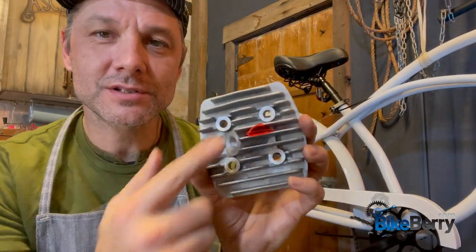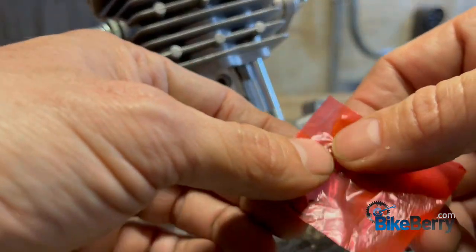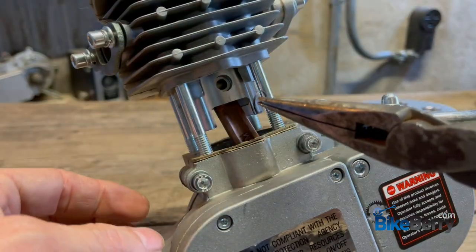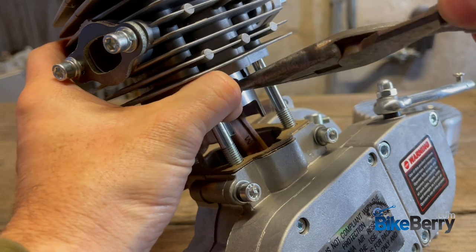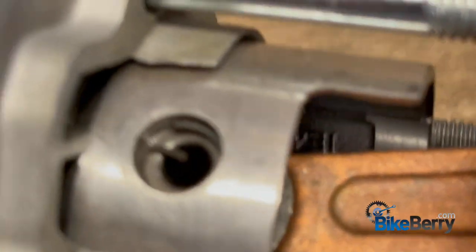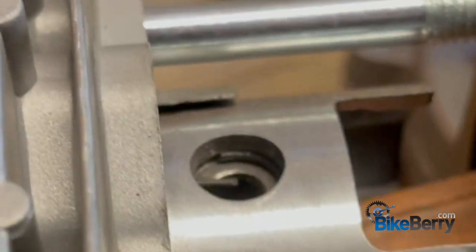When you unboxed your engine, you'll notice there's a little red bag in the stock cylinder head — that is your clips. So take one of those clips, get some needle nose pliers and wrestle that thing in there. You can see the part that I grabbed with the pliers is in the groove in that slot, but if you look over here this part isn't — you got to push that in. Just like that.